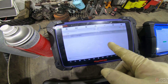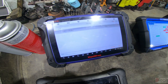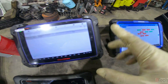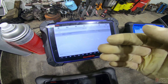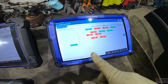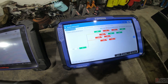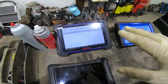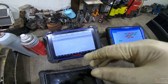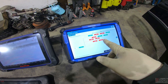Autel has been on and off with communication as you can tell — earlier I was able to get a scan. But the problem I ran into, which is why I grabbed this one, was that Autel was pulling the list of modules but would not pull up the transmission control unit, which is something I wanted to look at. When I powered this one up, connected it, it made the module tree and had the TCM listed — and on top of that it scanned it and found faults. I was extremely surprised that Autel couldn't even pull up the transmission module when it communicated, while this one always communicated and always pulls up the TCM.